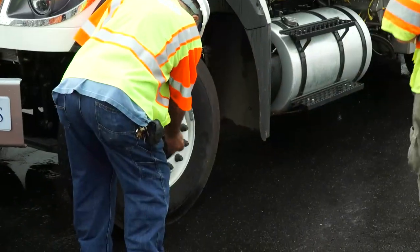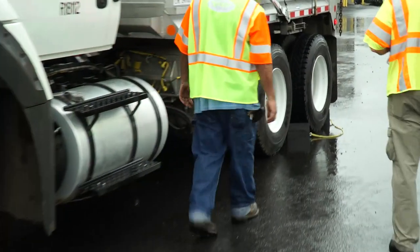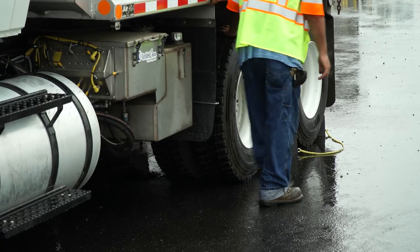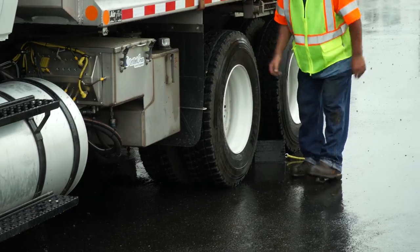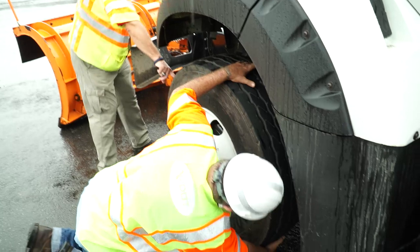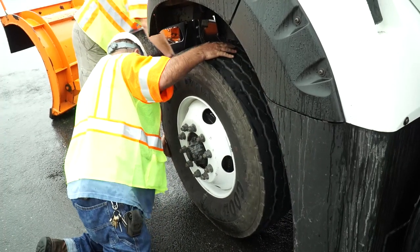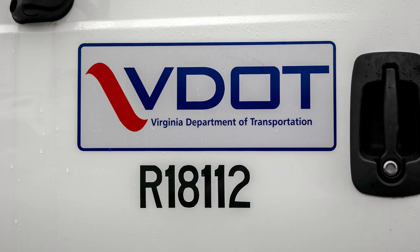Check for major fluid leaks around the inside and outside hubs and around the brake drums and calipers. Also look under the truck at the end of your inspection — there should be no fresh puddles larger than about four to six inches in diameter. Tires must be in good serviceable condition with adequate tread and no major gashes. Company identification placards must identify the actual company that's on the contract. The placards must be legible and firmly attached to both sides of the vehicle. If the placards are the magnetic type, inspect them for good adhesion.